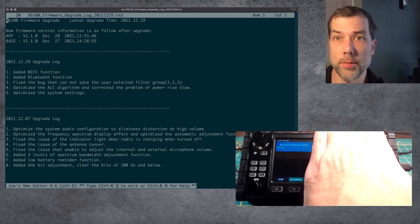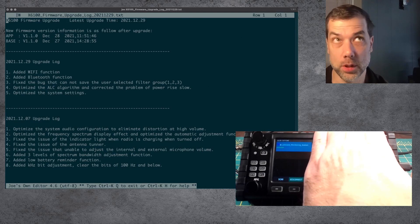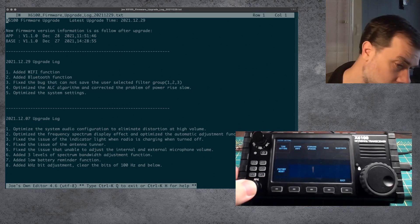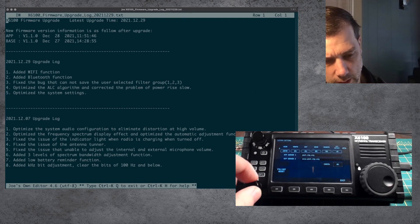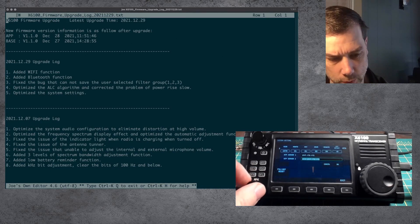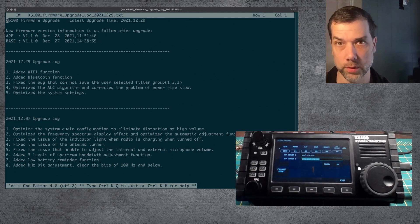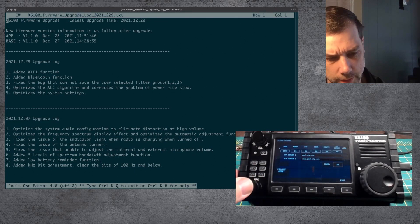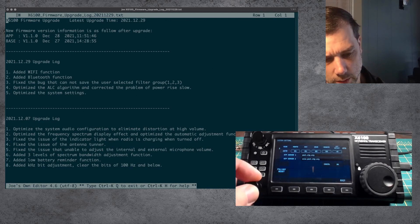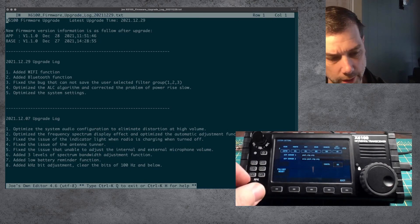Let me get out of this screen and we will check whether this thing can actually do network time protocol, as it had indicated it was going to try. Now we're back at the system settings menu. Let's do time setting — there isn't any NTP update option. It has two different NTP servers: pool.ntp.org and asia.pool.ntp.org. It doesn't give me the ability yet to hit the NTP update button to actually go out and get the time and set it, because I know the time is wrong.